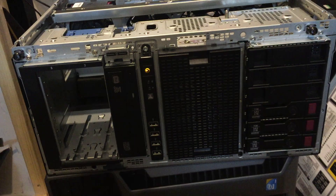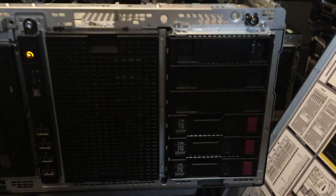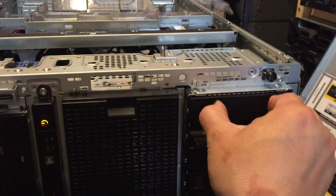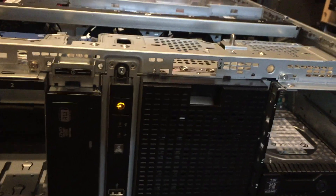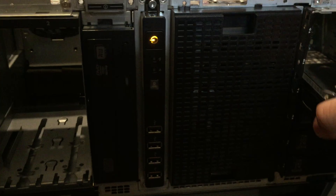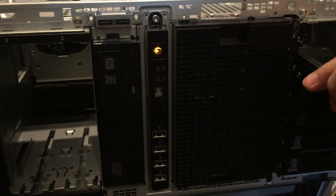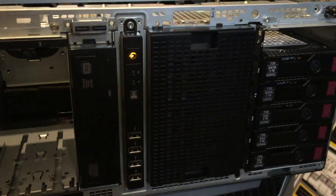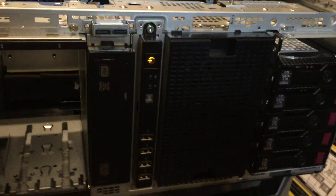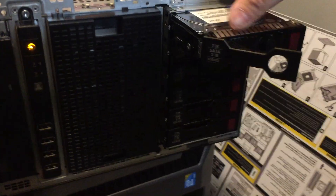Welcome to the video. We have a Gen8 ML350P server with the 6-bay large form factor format. It's quite easy to take it out of the empty cage. Note that the Gen8 and Gen7 caddy look different, so make sure you fully insert and then clip it on — if you bought the wrong caddy it won't work. On the back they've got a smart sensor, so just fully insert the hard drive and click it on.